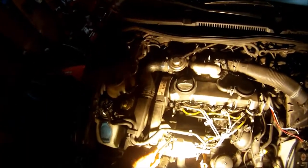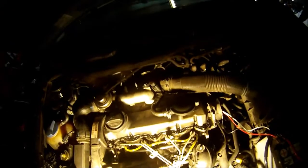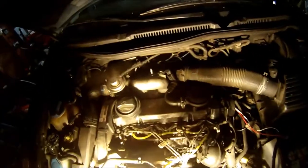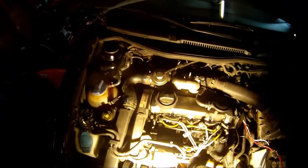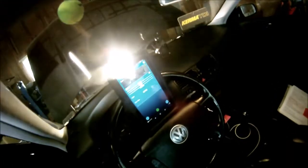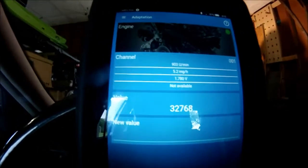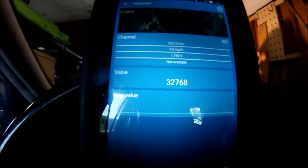So from what I gather, we loosen these three bolts just a little bit. I have a brass hammer and a 30 Torx driver — we're going to tap it that way and see if it changed the value at all. It did — we are now at 2.2 at factory setting. I pretty much used just the weight of the hammer. And now we're at 32768, at 5 on the IQ at 903 RPM. So it definitely works.